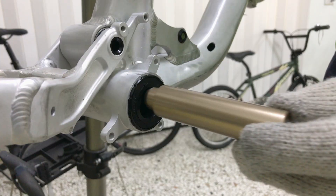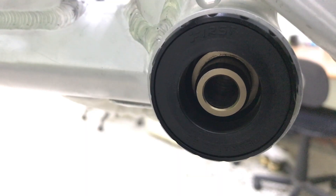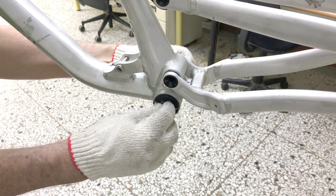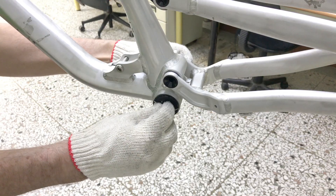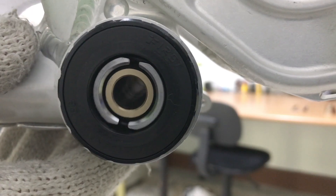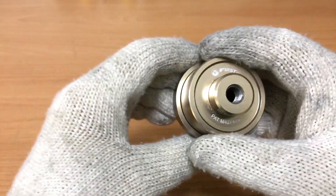You need to install the driver first, then install the split steel hitch onto it inside the bearing cup. The split steel hitch expands over then locks onto the end of the driver. The retaining cup holds the bearing cup when it's pushed out of the BB shell.